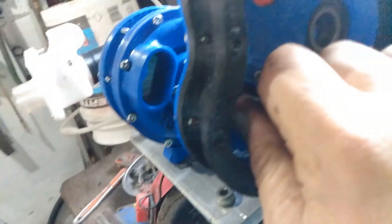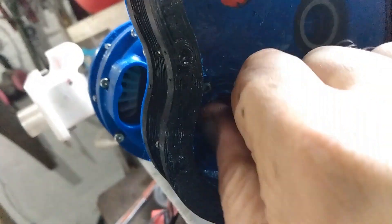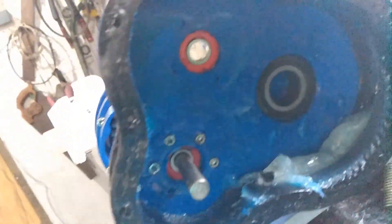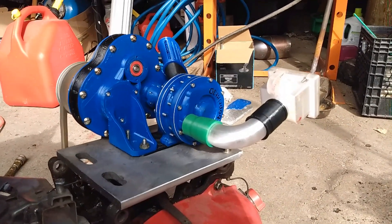With the front cover off I can investigate, and apparently my final drive is slipping on the shaft. As you can see here, either I didn't tighten this up or it untightened itself. Either way, it came off and started moving around, and then I imagine with the bump in RPM it just completely started to slip and shredded any fit that was left. While putting this together I really wasn't happy with the amount of taper interference I ended up with, so I'm going to reprint the parts with a little bit of modification and hopefully get them to tighten up better on the shaft — otherwise I'll have to find a different way to mount this to the shaft.